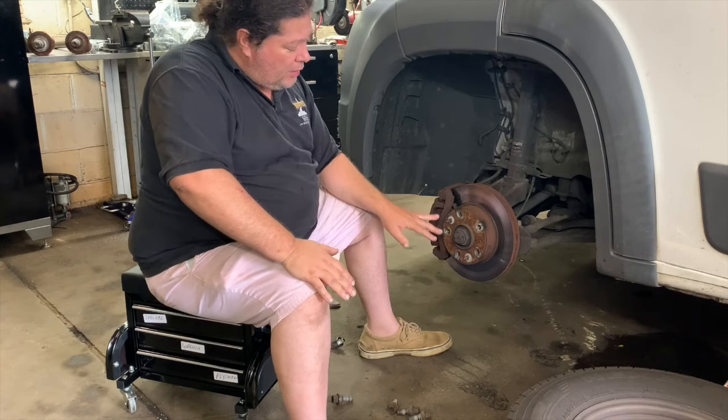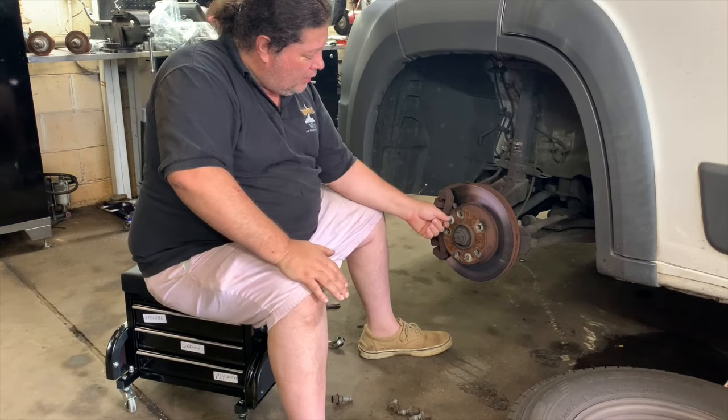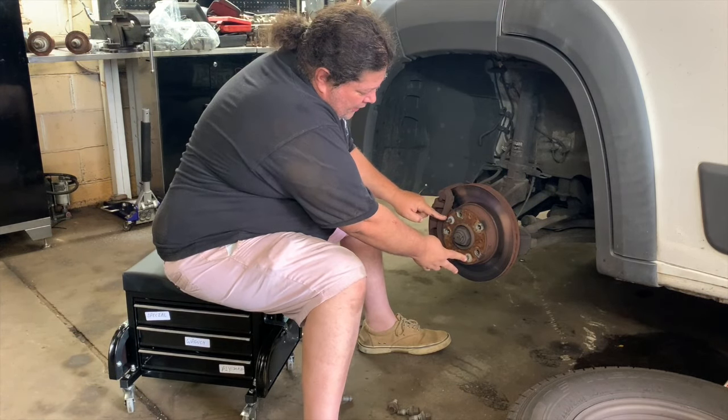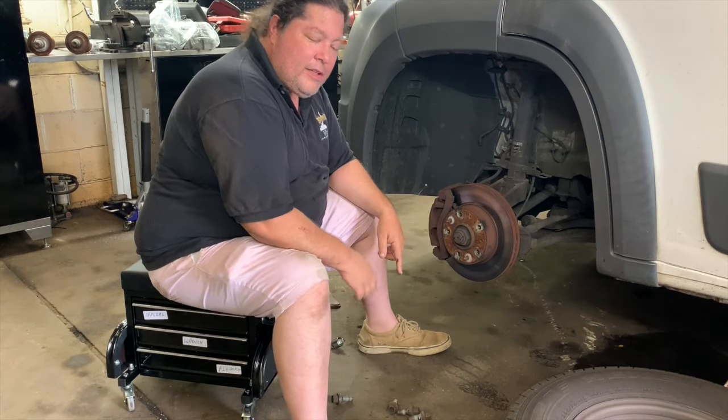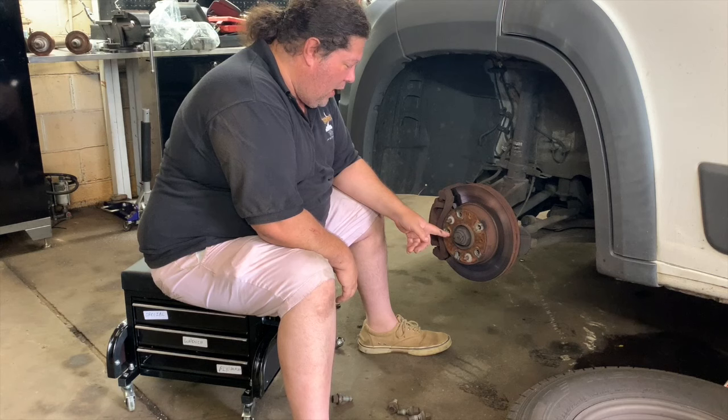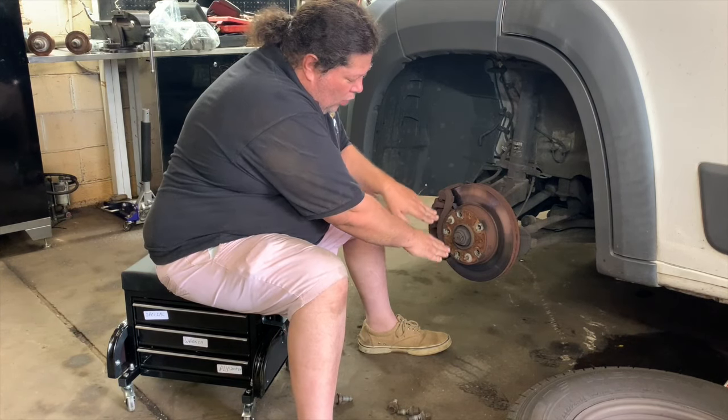If you have one or neither, you'll also notice that these two are biased — they are not in the center. If they were in the center, they'd look more like this. It's biased to one side, and you'll have to figure that out on the tire. If you don't know that, you'll fight with this for hours trying to put it on in a way it'll never go.